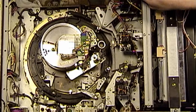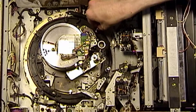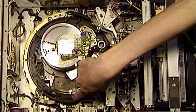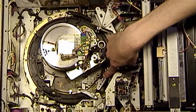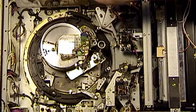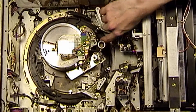The threading slider is essentially a little car that rides on a track and comes all the way around to here. Once it's there, the rest of the rollers mounted on stage three will take over. Stage three is comprised of the rollers on this black plastic threading ring — this, and this, and this, and this, as well as the pinch roller here. The pinch roller will end up coming almost 360 degrees, probably about 320 degrees, all the way around.